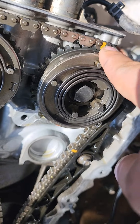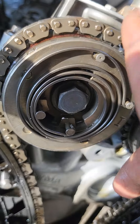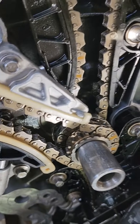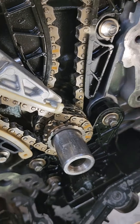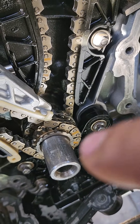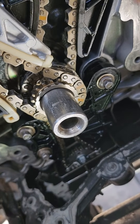These links — it depends on what you get — but these will line up to the circle marks, which would be right up here if you did the rotation. You would line everything up how it's supposed to be down there. There are timing marks behind those, similar timing marks like those right there, back there. Once you do that, you would install back the chain on the oil pump and put it back on the gear.